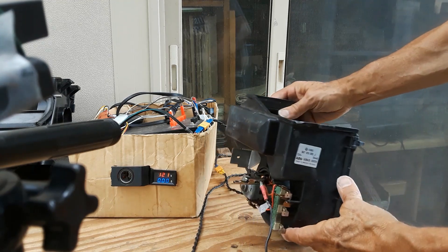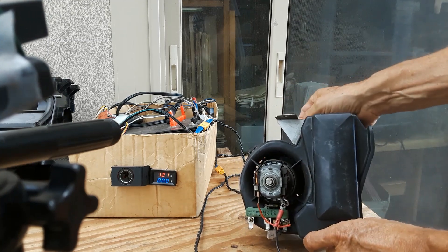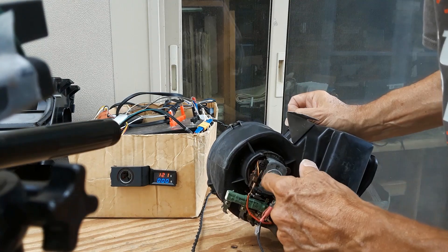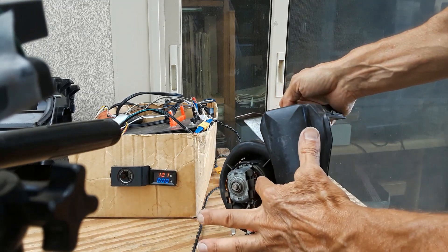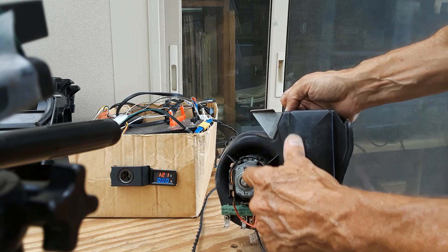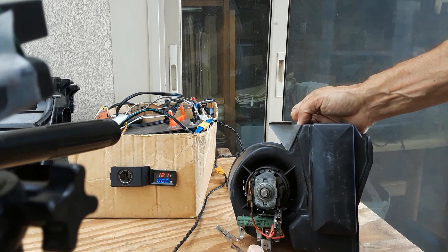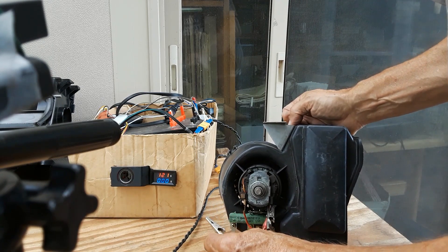Here's a view of the Vanagon motor. It uses magnets for the stator — there's a magnetic field on the stator. Brushes ride on the rotor here. And here's the bearing, which is the bearing that requires lubrication. It's wise to lubricate it on time, because this area collects dust, and dust collects around this and then creates a huge amount of drag.